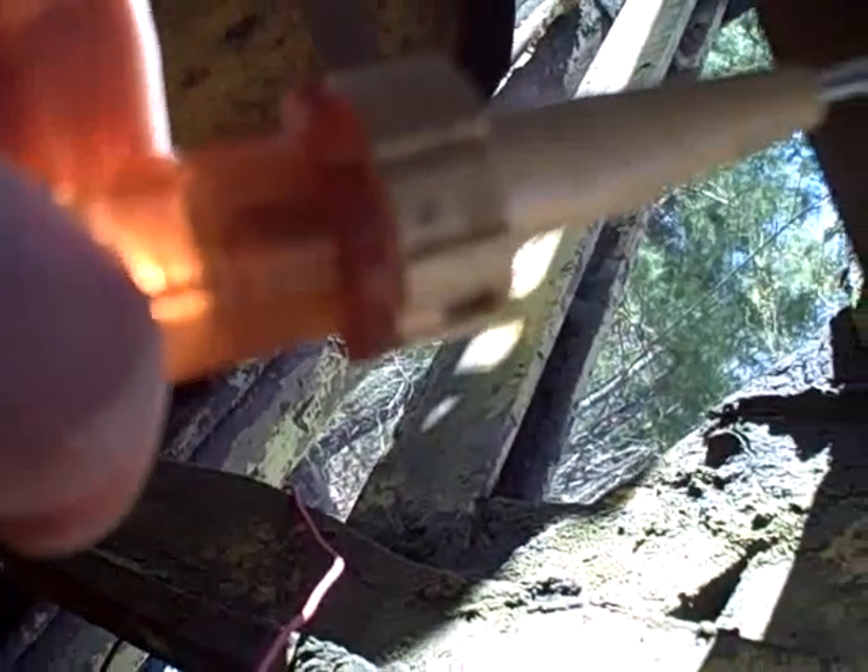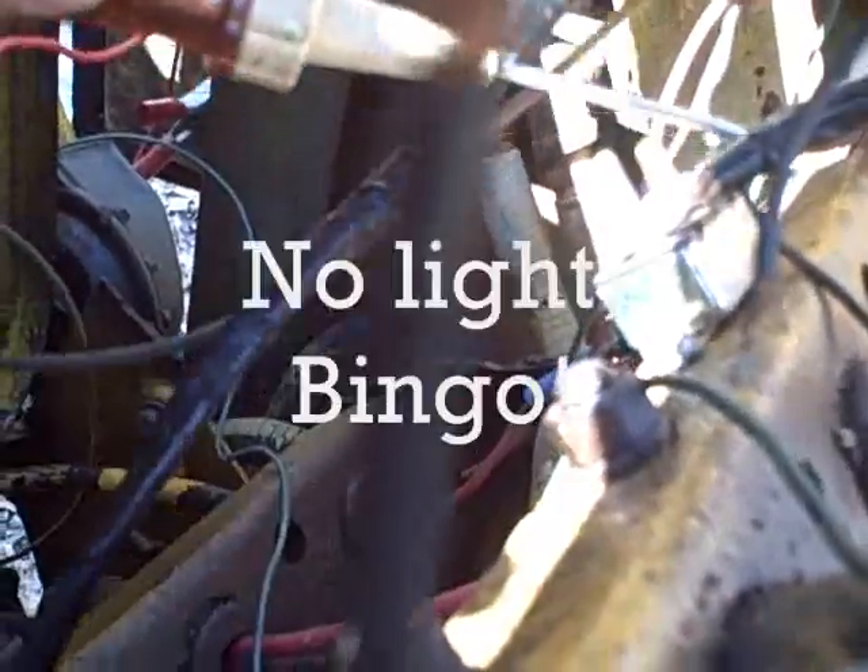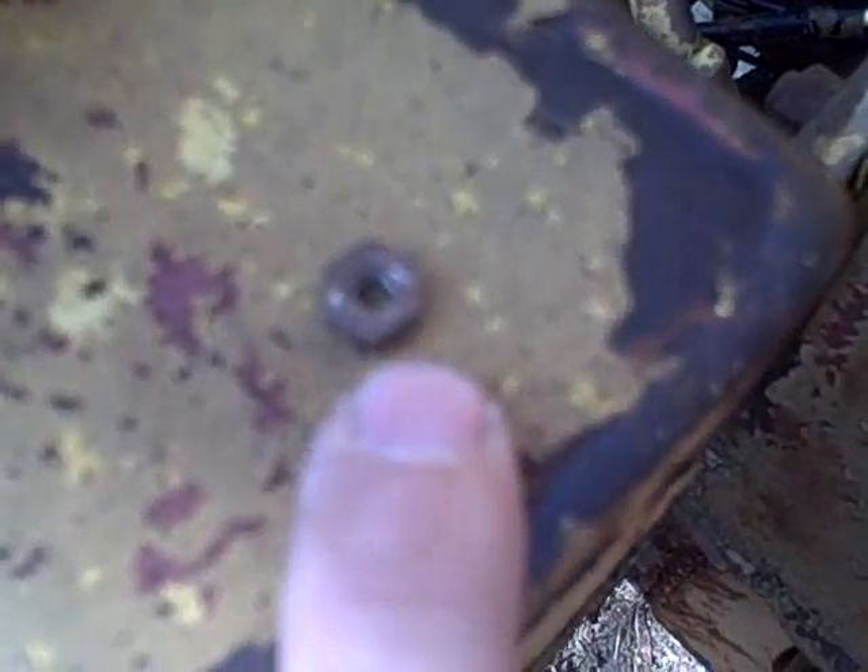I still think it's a bad connection here. On this side of the ammeter, where power is coming in from the battery, I can see the light lights. And if I go on this side and touch the actual post of the meter, the light lights. But when I touch this copper connector on the big heavy white wire — my feed down to the circuit breaker — I get nothing. I get that off. A rusty nut. Okay, let's retest. Oh yeah, now we get the light.